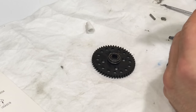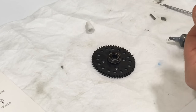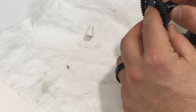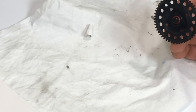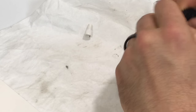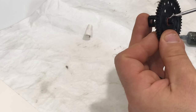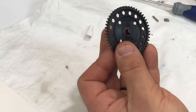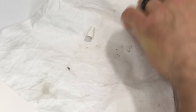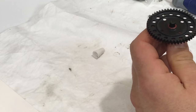That's a good quality feature on this vehicle - there are serviceable parts where you can add grease. You're basically going to slide that all through and use your fingers to keep that o-ring in place. If you want, you can use an instrument such as a pick, but be very careful that you do not break that o-ring. This is the part where I would normally install a washer or the optional shim to keep the o-ring in place.